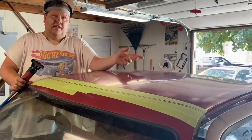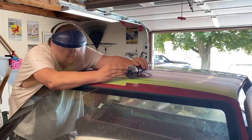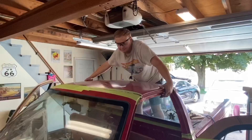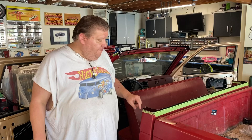Now we've got the cab wall cut — now it's time to cut the rooftop. As you can see, we've got our first cuts done and the top is off. We already did both cuts on the roof to make up for the three-eighths difference. We only did the one cut on the back of the cab wall so we could get the roof off. We still have to cut the bottom line and then take another three-eighths of an inch off. After we do that, we'll grind it off smooth on the top and back cab wall.